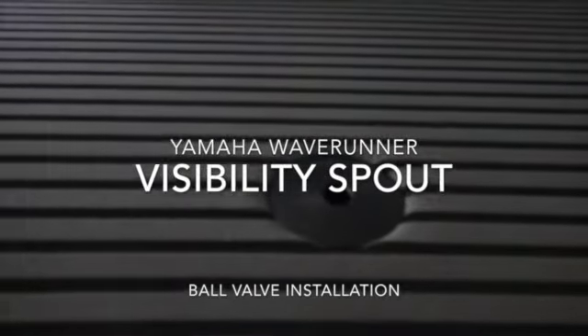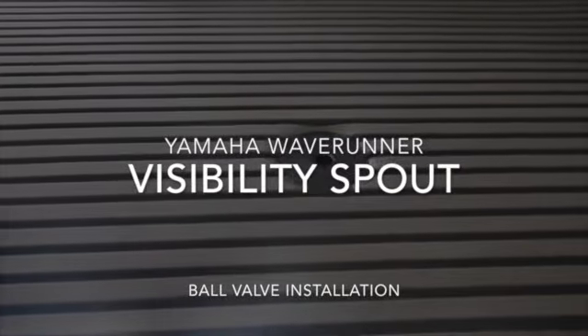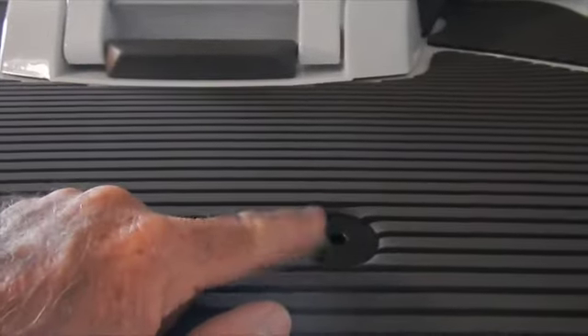Looking through the internet I could find a lot of articles about the spout but no actual instructions on how to take it apart or disable it, so we're going to cover that today. It's very simple and will cause no damage to your motor. This is the spout — the water comes out, and sometimes if the waves are the wrong way or the wind, it gets you wet. A lot of times if you're driving with a group, they don't want the visibility spout active because it gets everybody else wet, or if you're carrying gasoline or other supplies on your back deck it will cause a real problem.